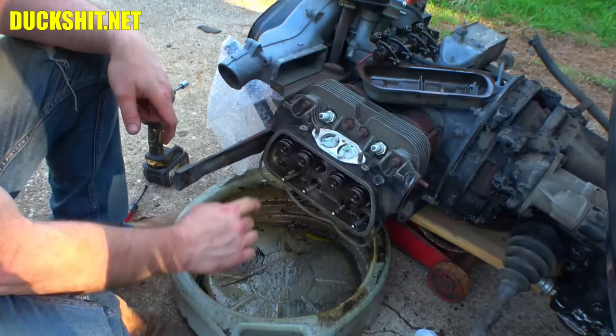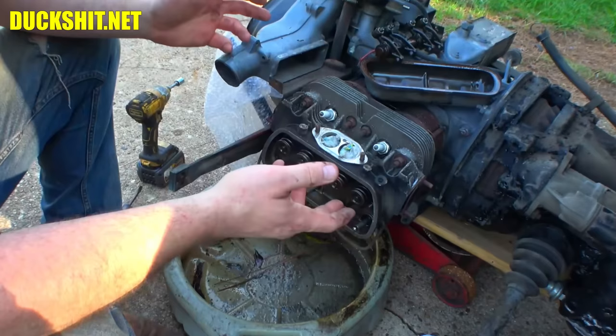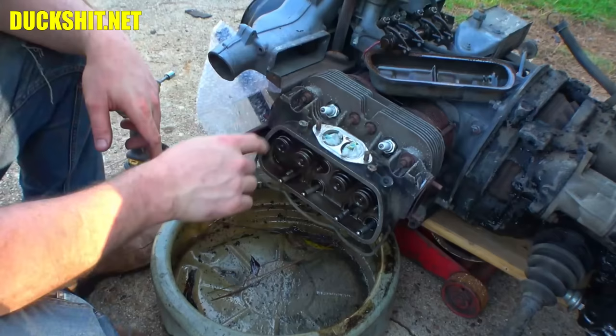The ones here on the top, typically they rust. So when you go to turn them, the whole stud will turn when you turn the nut on it. It's rusted solid. But these are the things we got to torque. This is number one, and then we go two, three, four, five, six, seven, and eight. And these have to be tightened too, looking at the size of the studs. These are going to be 23 foot-pounds because these are the big studs. Typically the studs on these things are smaller.